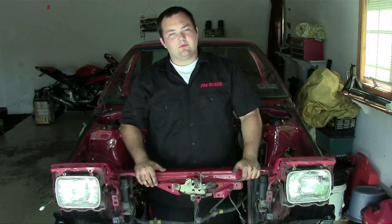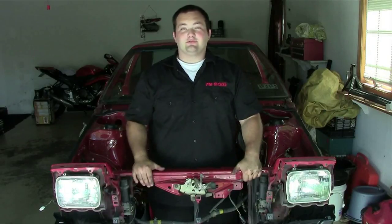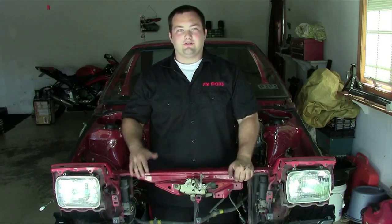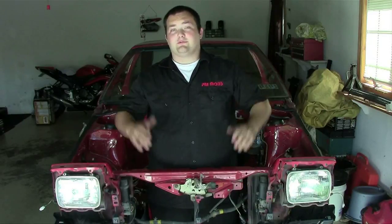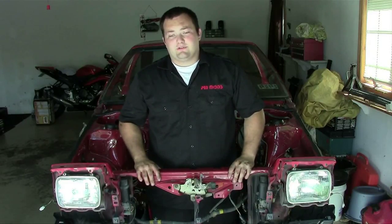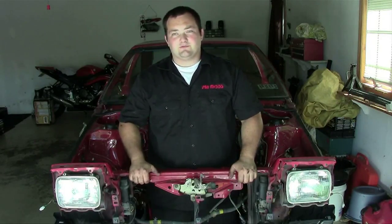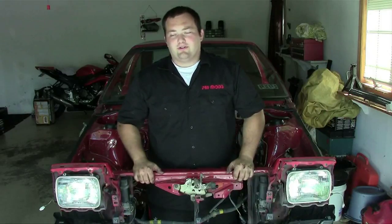Alright, so we've finished — we finished the front sway bar and got the rear sway bar done. Now that this thing has a full upgrade, it's going to handle so well through the turns — it's going to be quick and awesome. It's good to note that when we finished doing both sway bars, we went over everything with white lithium grease, even though we already greased the bushings. We just want to be extra careful and make sure there weren't any annoying squeaks, and we don't want the bushings to wear out — it's just preventive maintenance. It was pretty straightforward, just a few bolts. We had some trouble with bolts that were stripping, but that was kind of our fault. Hope you enjoyed it and learned something — thanks for watching.